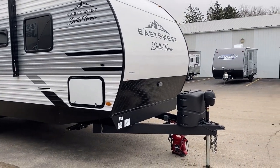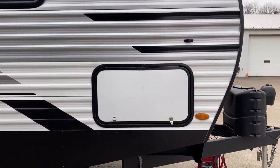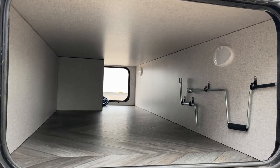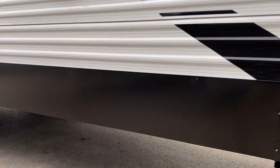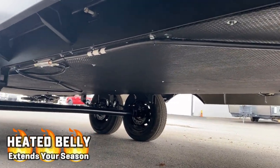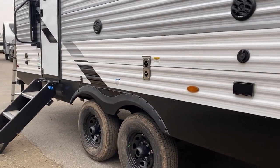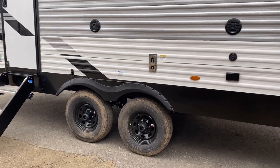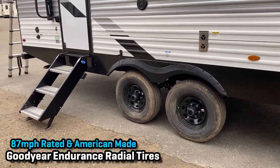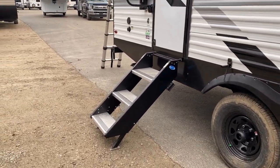They gave us a full big pass-through with large access doors on both sides — really nice, especially with that docking station on the other side. I also like that they included motion lights on both sides of the pass-through. Enclosed underbellies are about a dime a dozen nowadays, but in this class very few are actually forced-air heated. That doesn't make this a four-seasons arctic camper, but it does keep everything more comfortable and gives you a little more peace of mind. They also give you Goodyear Endurance radials and heavier-rated axles to support that bigger cargo carrying capacity.